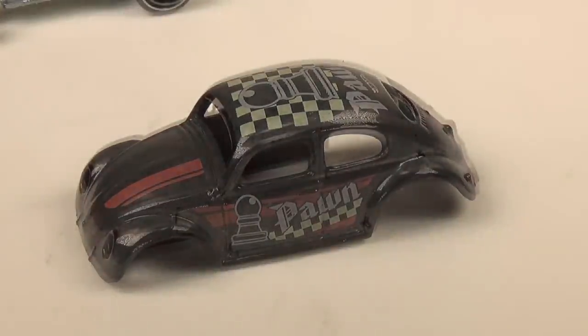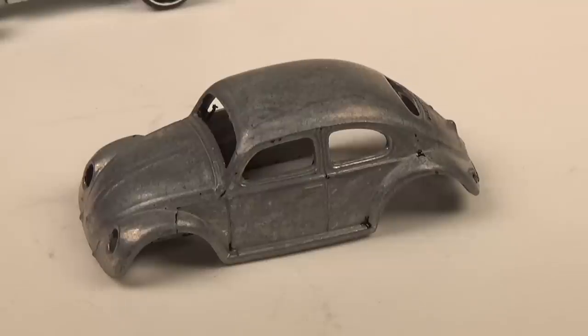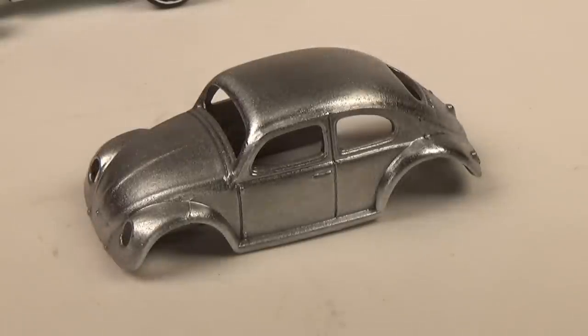The first thing I'll need to do is remove the paint, and I do this with some aircraft paint remover. Next I'll sandblast the car, just as I did in my previous video. I recommend removing the paint before sandblasting, as sandblasting the car to remove the paint can cause you to unintentionally sandblast away features while trying to remove all the paint. Next I'll go over the car with a soft steel brush to smooth everything out.